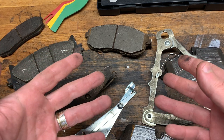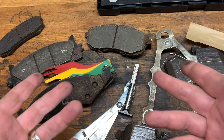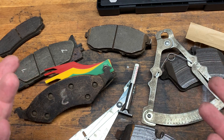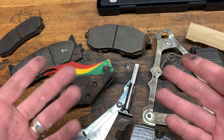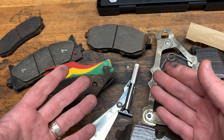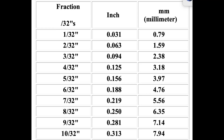Let's take a look at the individual types of tools that we have. But first, before we even talk about the tools, let's talk about the two measuring systems. We have standard — brake manufacturers here in North America measure in standard units based off an inch, breaking that inch down into 32nds. So 1/32, 2/32, 3/32, 4/32 of an inch. We also have the metric system, which we measure in millimeters.